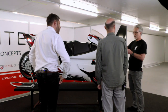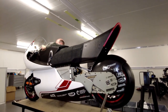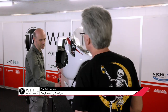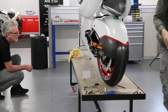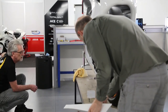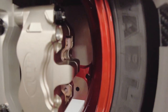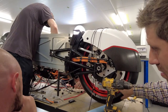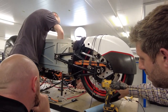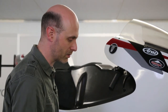The first magic bullet is the front suspension — obviously we need bump travel, we need steering, and all of these gaps in here need to be managed to allow for that. But at the same time we don't want the air to get stuck against the front of the belly pan and create a high pressure area there. The hub center steering is effectively a necessary solution to remove the need for forks.